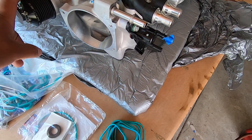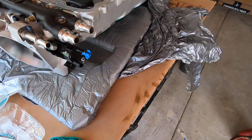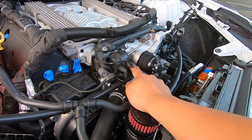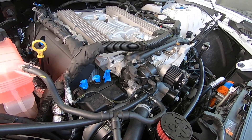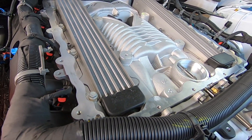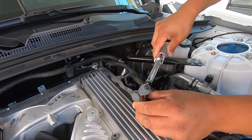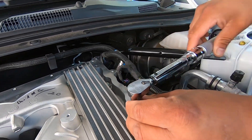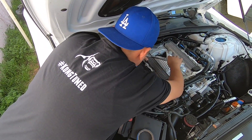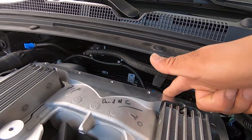Now we're going to get ready to put the supercharger back in the car. We won't be able to record that because we don't have a tripod right now, so we'll put you back on once the supercharger is on. In the front passenger side there's a guide pin, and somewhere in the middle it has a vent that goes into the supercharger, so you have to make sure those are seated properly. We installed the mounting bolts and ran them down with the ratchet, and now we're going to torque them down to 89 inch-pounds. Don't forget to connect the sensor back here behind the supercharger.